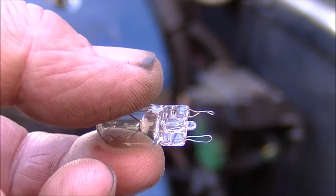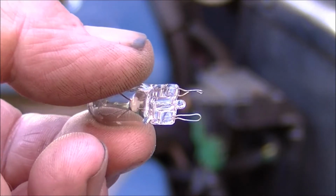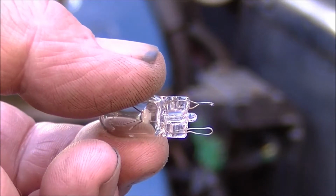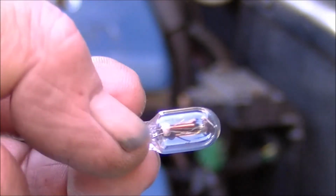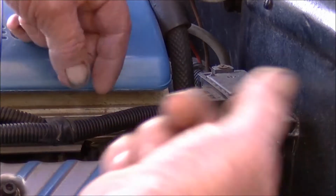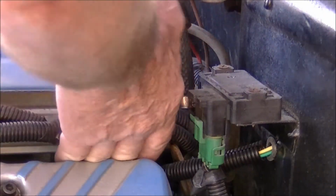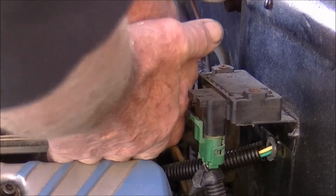This is for Kevin K.E. Robinson. Kev, my mate over there, with playing around with a Chevy truck. You want to check your injector pulse, you don't need to go and buy those Noid lights. You can just use a normal globe. And what we'll do is, by the way, when I looked at this, Kev, I do appreciate actually that you had this issue, and I thought I'd come out and do it because my return line was leaking fuel. I'm just going to snip one of the injectors off.